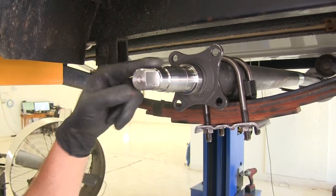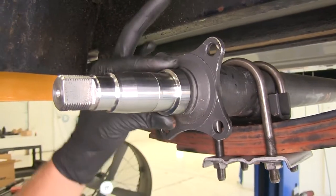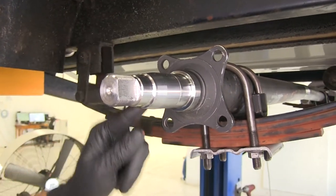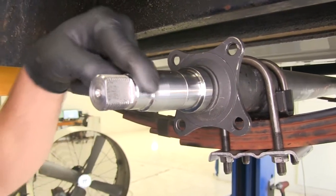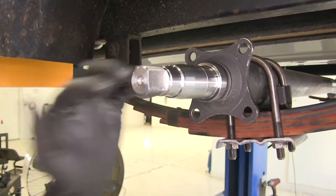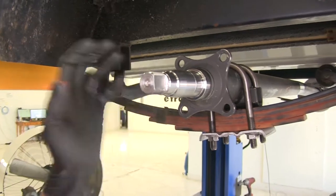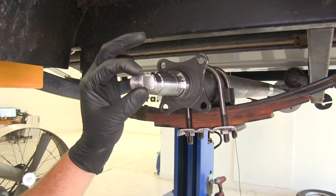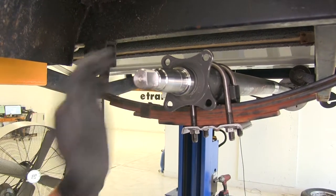Here's a good look at the spindle on the axle. The seal provided will ride along that and prevent any grease from coming out. We've got our inner bearing surface and our outer bearing surface. Everything's nice and clean, brand new, ready to go together. The seal, both bearings, the nut for the end, the keeper — everything's going to be included.